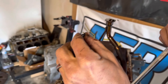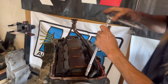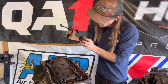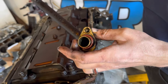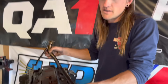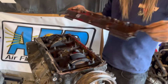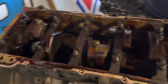I've been finding a ton of little tiny bits of plastic — that's a piece from like the wire loom, and then I found a piece of cracked lifter trays. No pieces of metal, just some pieces of plastic so far. This O-ring doesn't look too bad — these will flatten and you'll get low oil pressure in the cab because it's just seeping by. That's a pretty difficult thing to do in the car — not impossible, just pretty labor-intensive, and these things are old where people don't want to do them.